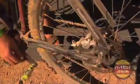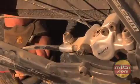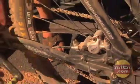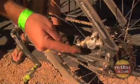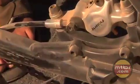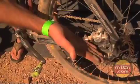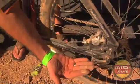All of the labyrinth seal cups have the EcoLink system etched on them and the torque specs for the bolts. Moving to the back, you've got inside mounted calipers on the rear rotors and brake caliper. What we do is we hide them inside the chainstays and seat stays to protect them a little bit from the outside, and by mounting the caliper to the chainstay itself, it acts as a long beam so that when brake forces come into the rotor, you can see they spin around and want to come down straight into the chainstay tube itself, effectively wanting to rotate the tube down on braking.